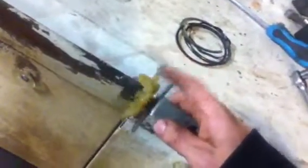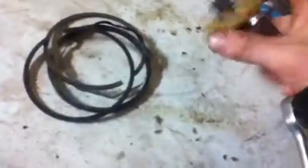The governor looks pretty good. This is also the oil slinger - since it's a vertical shaft, it dips down into the oil and connects to the cam. As it spins, flyweights come up and control the governor, which I'll explain in a separate video. It flings oil up everywhere. It does feel like there's some resistance - some dirt in it - so I'll make sure that's cleaned out.